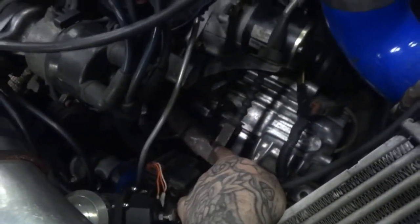But yeah, the clutch is in. It works. The grab point is really weird. There's literally that much pedal at the bottom and that controls everything. You can move half the pedal before it even moves this arm right here. I'll have the pedal halfway depressed and that won't even move. And then, like I said, the bottom 2 inches of the pedal are where all the clutch is, which I guess I'll just have to get used to. But I put it in gear, moved it frontwards, backwards, it goes into forward and reverse. It grabbed fine, so all seems well on that front for now.